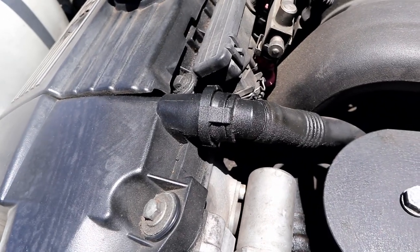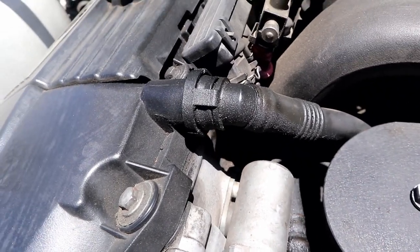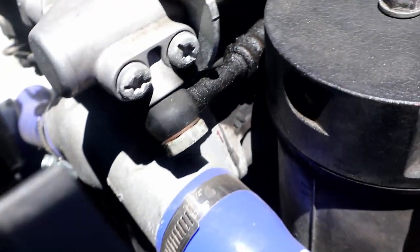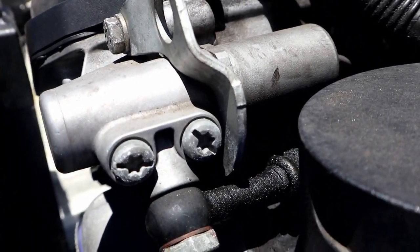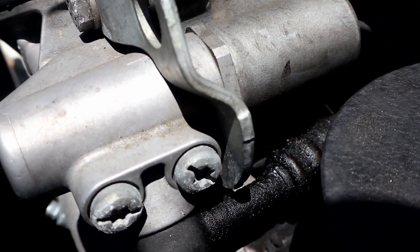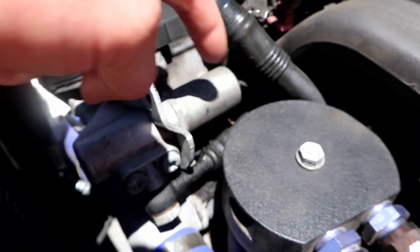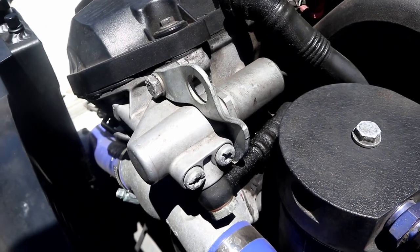And when the PCV system vents, it's venting as oil vapor, and that oil vapor collects and condenses on there. And it's starting to get a little bit onto the valve cover grommets back there. And here we have the Vanos hose. The crush washer looks like it's starting to seep at the top up here. You can see the line getting a little bit of oil vapor and oil on it. So that's what it looks like when your lines are sweating. And sometimes these lines themselves can sweat from the junction fitting onto the actual rubber hose itself from the metal. So these aren't that bad.